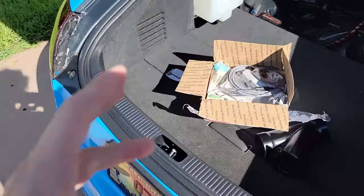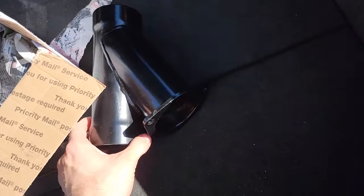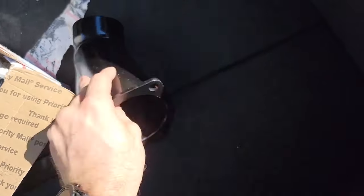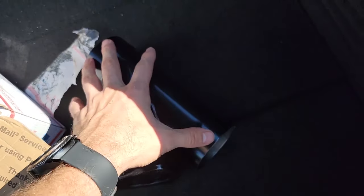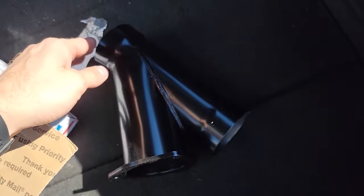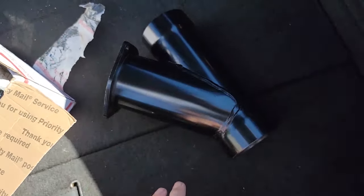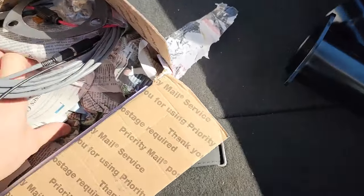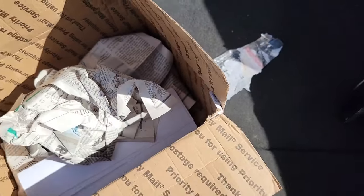The GTI had a three-inch downpipe. What we're going to do is weld this onto the downpipe before it gets turned into the two-and-a-half inch piping, so it'll go on like this, and there should be a little valve thing in here.